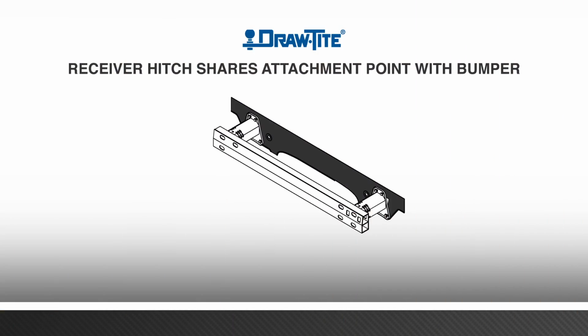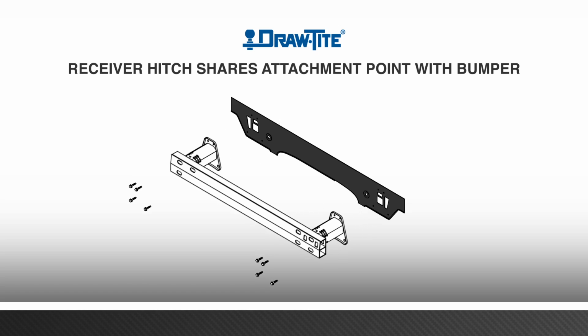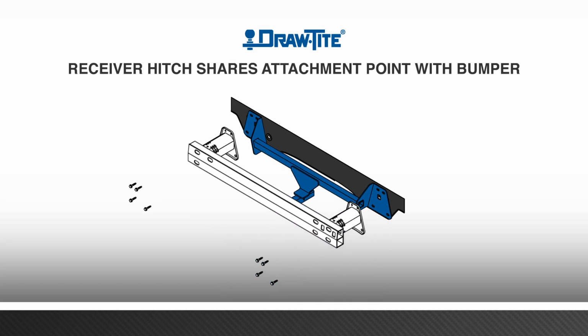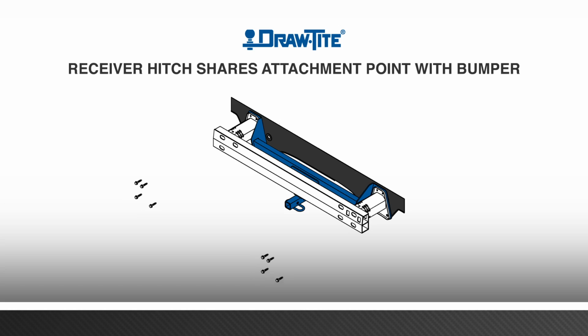Some installations require the hitch to share an attachment point with the bumper of the vehicle. In these situations, loosen the hardware to remove the vehicle's bumper, then install the hitch by aligning its holes to the attachment points in the vehicle's end panel. Once the hitch is placed, reinstall the bumper beam so that it sandwiches the hitch against the bumper end panel, and tighten all the hardware.